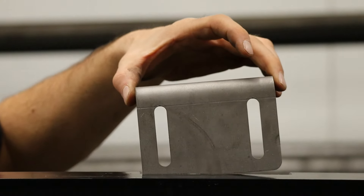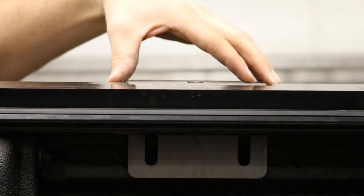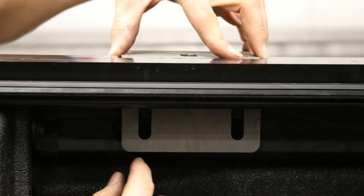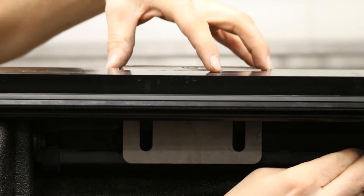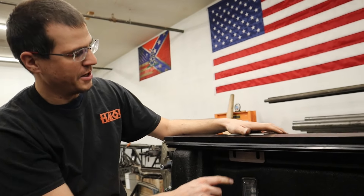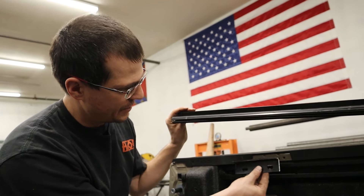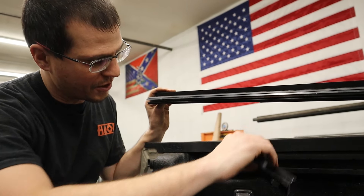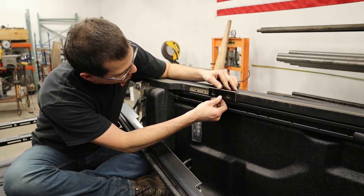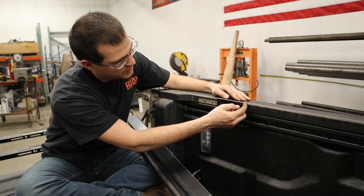As you can see, this drops straight in and will sit flat on top of the bedside. Your T-slot nuts, bolts, and all your hardware are going to secure the rack to the T-slot rail that's in here. With this plate mounted here, as I mentioned earlier, we had to cut this part out — this is what actually holds the channel against the bedside like this. So what we're going to have to do is bring it over here, take this, go right to the edge of where this cutout is, and make a scribe here.